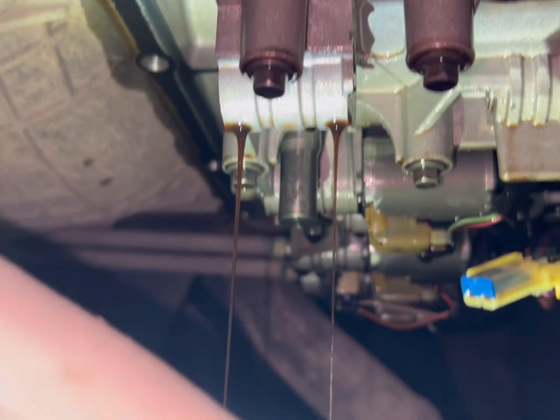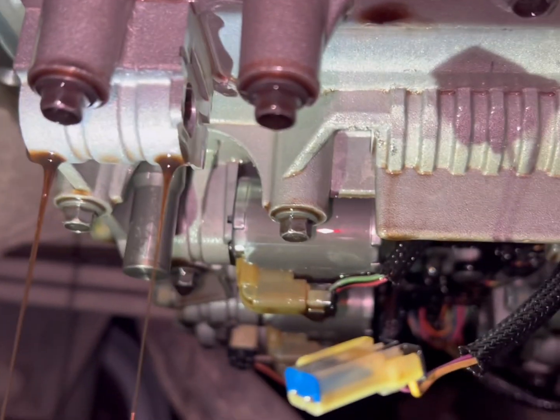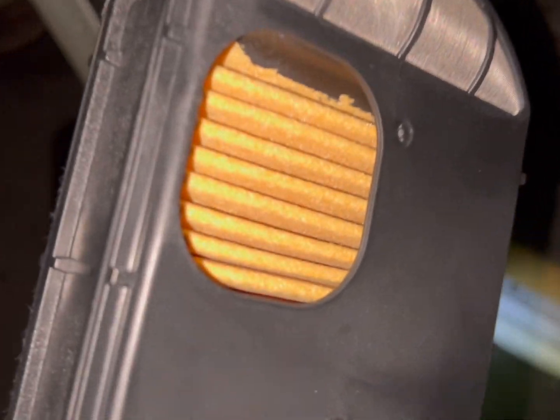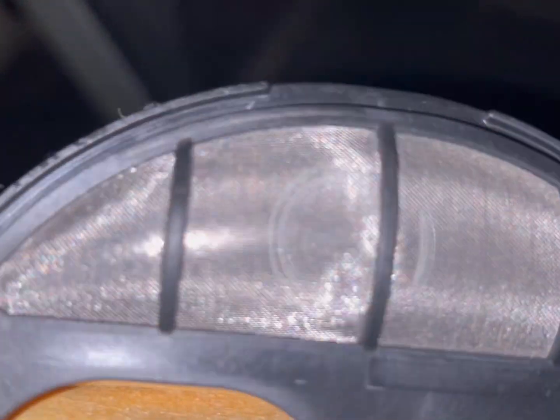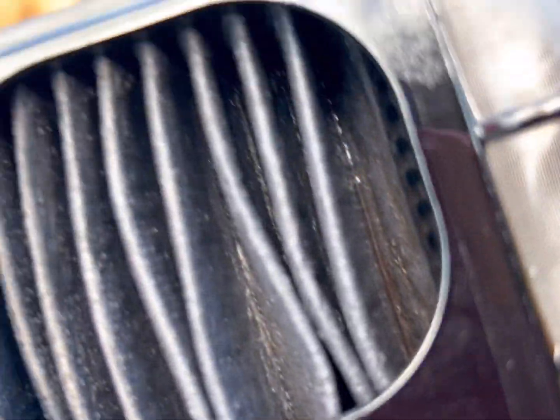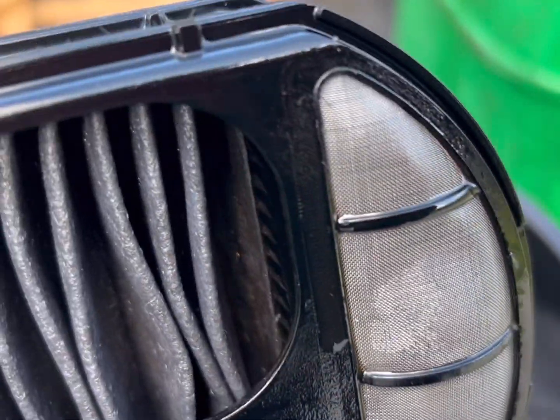What I'm going to do is put new transmission fluid in, being that it's in the neighborhood, and that's it — I'm going to be done for tonight. I'm going to put the new filter in and dispose of the old one. I'll close this up so it doesn't sit open, and then come back tomorrow and see what I can do. Here's the new filter right here — you can see how clean that looks inside, and the little screen filter. Here's what the old one looks like — it's so dirty inside. You can see the screen.